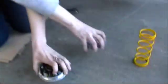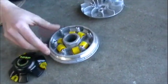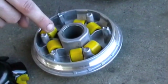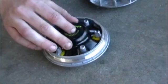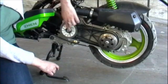Next, we're going to break down the variator. The variator is made up of two discs that look like this. When you're parked, the discs are in this position. As you move faster, they move closer together. I'm going to show you why that happens. Underneath this plate are roller weights. As the variator turns, these roller weights are pushed outwards due to centrifugal force. When they're pushed outwards, it causes this plate to move upwards, which then causes the belt to open, changing the ratio between the variator and the clutch.